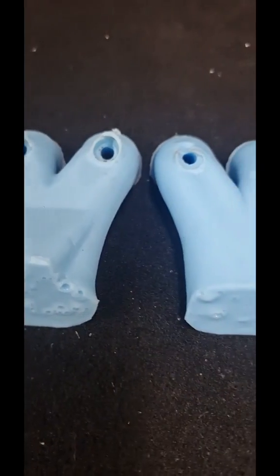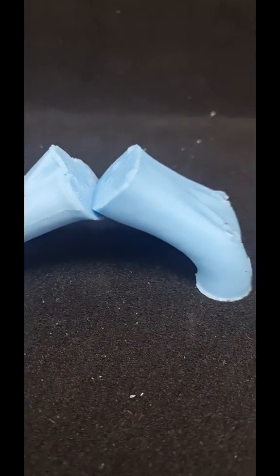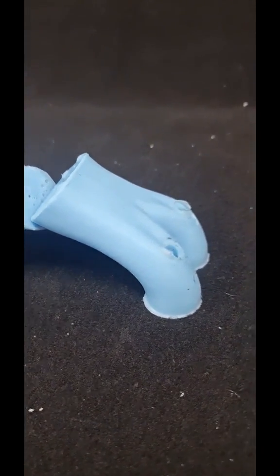And you can even see it in the centre line of the port. The factory centre line is about 3.9 inches; ours is now 3.76. So we've also straightened the shot to the valve.